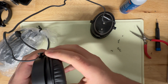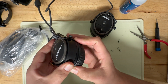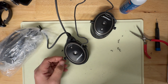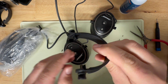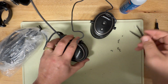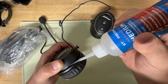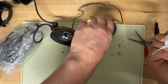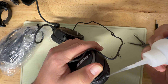One issue I've had with a few of these is they will wear out and rotate over time, wearing out those nubs. You can see right here the nubs that lock in are keyed into the headset — those can wear out. To prevent that from happening, just put a dab of super glue right at the apex of the ear cups, and that prevents the rotation so you won't have any issues.